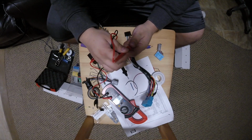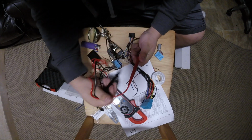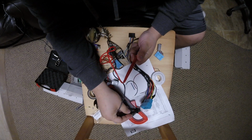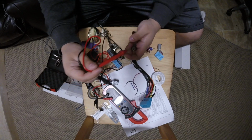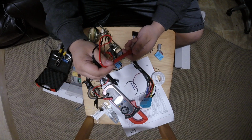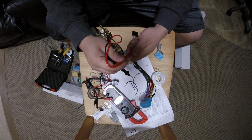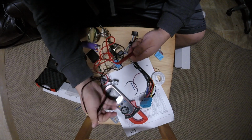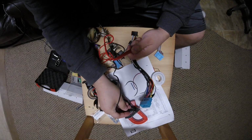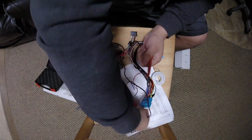It reaches here, so it should reach here, and there's our beep, so we know our remote turn on is good. Now our subwoofer, if we reach here, see this has two, so it might be tough. I don't remember which is which. I think the shield is the negative. Nothing there, nothing there. There we go, there it goes.